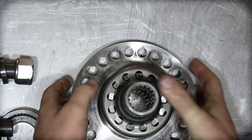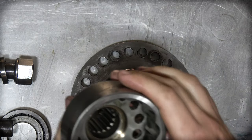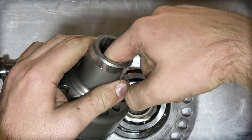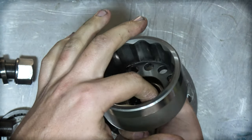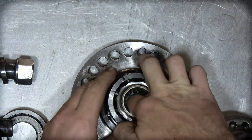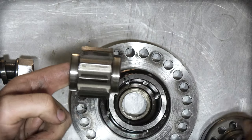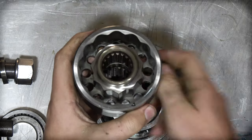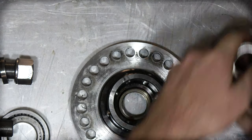Here's the cam and pawl. This is the outer race which is what drives the right hand side of the car — the flange goes in there and then we have where the pawls will drive against. The inverse of it is what does the left hand side, so that pulls out — the left hand side flange would be in here, right hand goes over there — and that leaves us with the pawl carrier which fills the gap here.